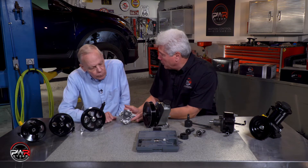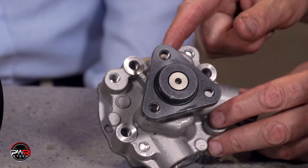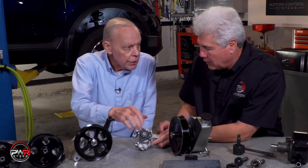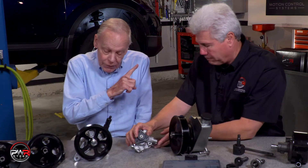In this case here, I've already removed the pulley — to show you the installation holes are in the back of the pulley. So you have to remove the pulley to install the pump, and then you put the pulley back on, attaching it to the flange. Three 10 millimeter bolts, factory spec torque. Always.